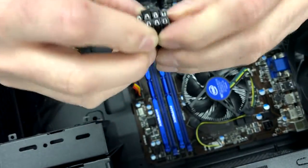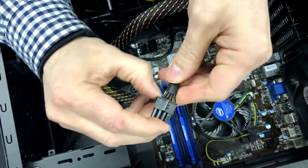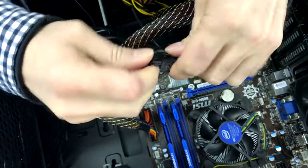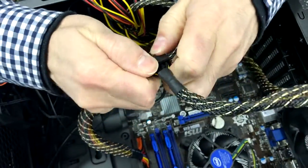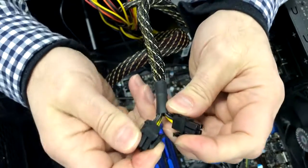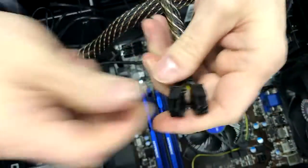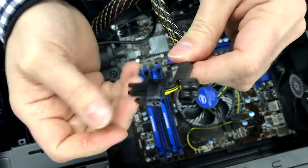As you can see, there's a little line down the middle — not really obvious on this one, but you can really tell on the other side. You can see the little grooves. So they'll usually slide apart from each other on this particular model of power supply. This one is stiff, but they definitely will separate. This one actually pops into place — it doesn't really separate, it's got these two little hooks in there. So it pops in and pops out. Normally they slide back and forth, but this particular one's a little different design. And there we go — we have a four-pin connector.